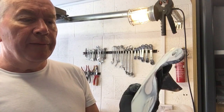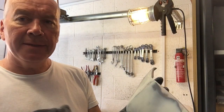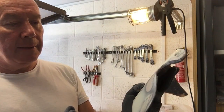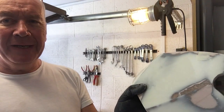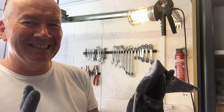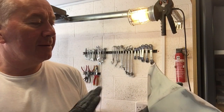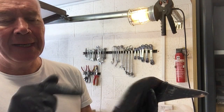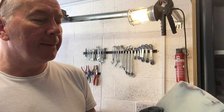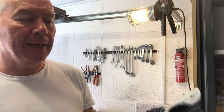So I've been using the dolphin glaze and filling in all the minor imperfections and moving up in terms of the fineness of emery paper. Getting a reasonably good finish. Still not sure that it's going to be the final thing. But we're getting there. So after this, I'll rub it down, just clean out the drill holes that I fitted, and give it a trial fit and get another coat of primer on it.